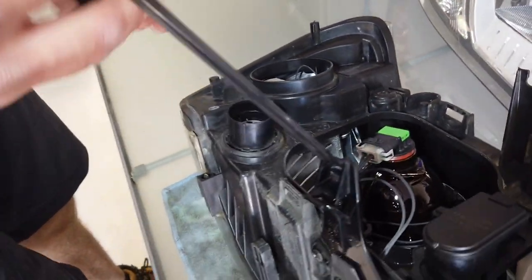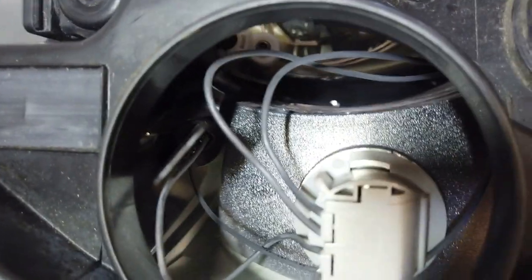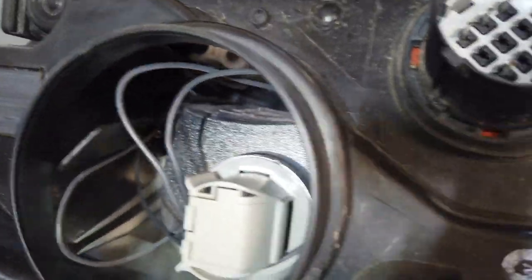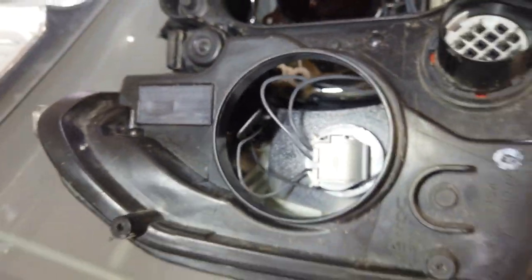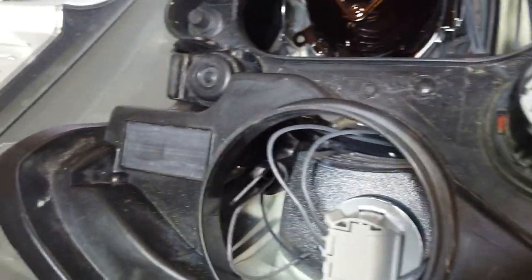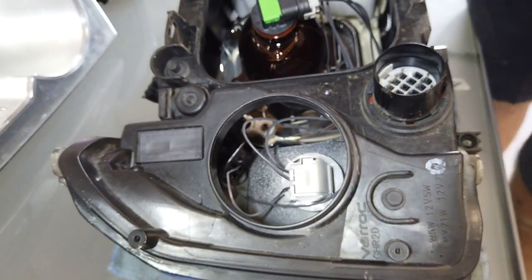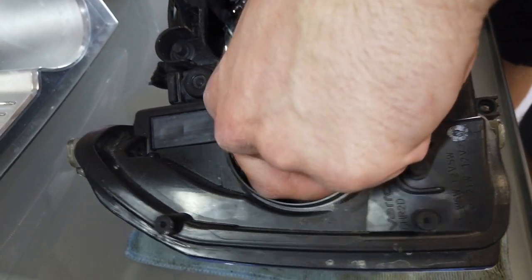Let's get that rubbery inspection chamber off and swap sides. In here you can see the indicator bulb there - that looks easy enough. And then there's this funny little spatula-like thing, which is a secret little stick that on the end of it has got the sidelight bulb. Let's do the indicator bulb first - give it a bit of a twist anti-clockwise.